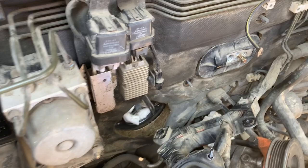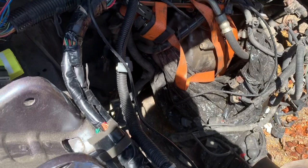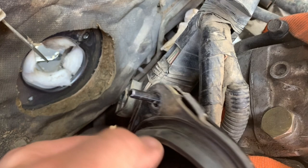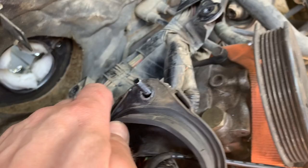I managed to pull out all the wires that go into the interior. Don't forget this bolt — it's a 10mm and it's really hidden. If you don't undo it, you kind of have to angle-grind it or try to take it off with a plier, but that's not going to help. You really have to take it off with a 10mm. It's well hidden, so you have to find it near the hole. I'm going to remove it and compare it to the one I have.